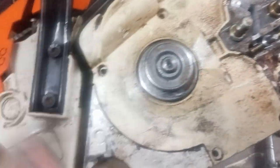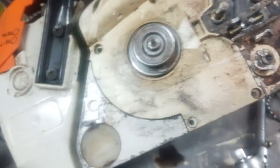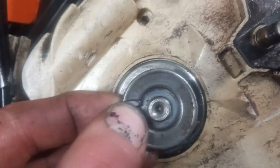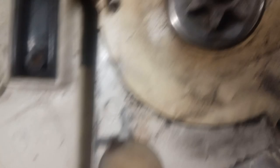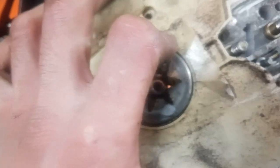On the side here there's a bunch of little torx screws. And then there are a couple of clips — a couple of C-clips. The first one is a small one that holds this washer on. Set that to the side. And then there's a bigger one that holds this cover under this gear. And that all just slides off.